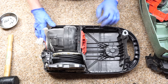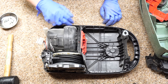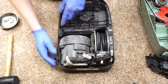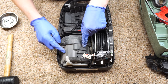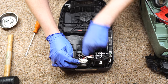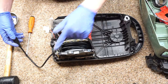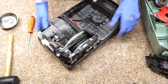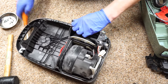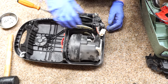Just a quick tour of what we're looking at. There are some things on the C2 that are not on the C1: one is this nice big seal which has come off with the suction. The other is that this machine was the first in Miele's lineup to have the motor completely encased in a plastic outer casing. We can see the rest of the motor hiding right here. This also has what they call one-touch cord rewind — you just press it once and the cord goes in. As I pull this out you're going to see the counterweight, and there are multiple clips you have to pull off.